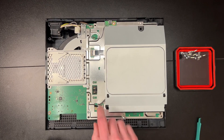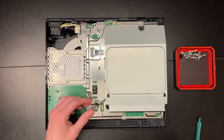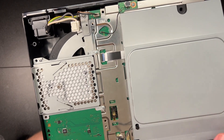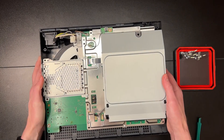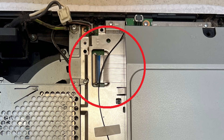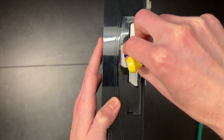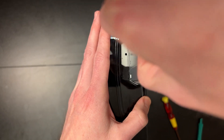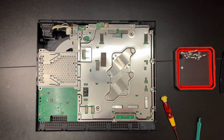The disk drive has one power connector at the bottom and a ribbon connector. Gently lift the black plastic clamp and pull it out. Be careful as the black tab can break easily, though it's not as bad as the A, B, and E model PS3s. If you're on the K model, the ribbon cable will be slightly larger but removing is the same. On the bottom of the console there's a plastic door that pops right off with the blue Phillips screw — this is where your hard drive is located. Make sure to use the correct driver as it can strip easily, then grab the latch and remove it.